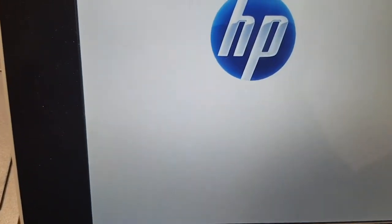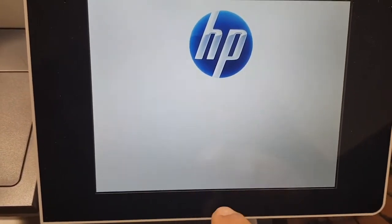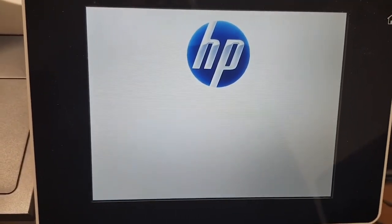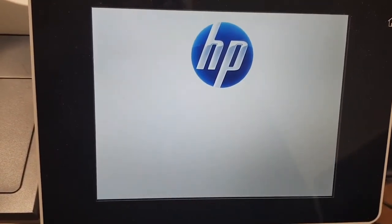The trick is to tap the HP logo, but it won't work right now. There is a stage in the boot process when you see the first step of many — that's when the tapping of the logo would kick in. Let's wait for that.